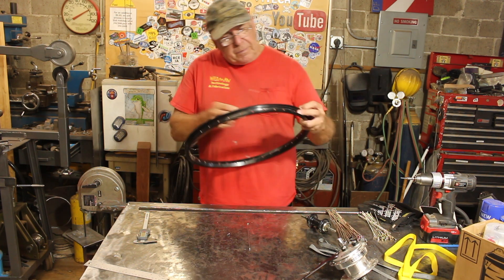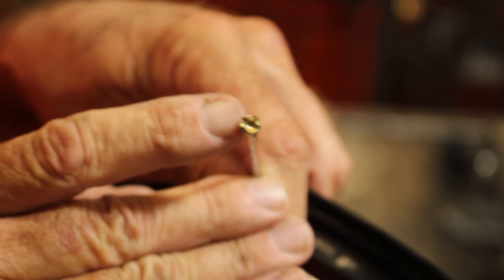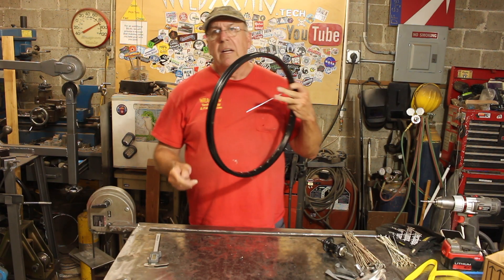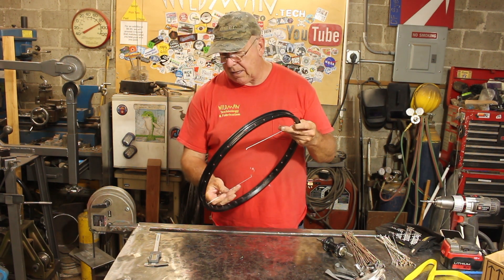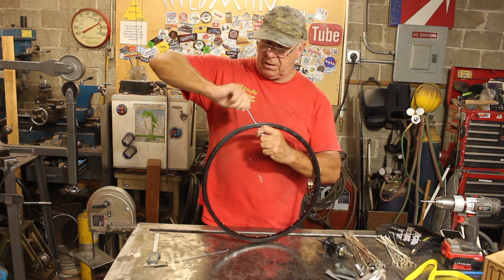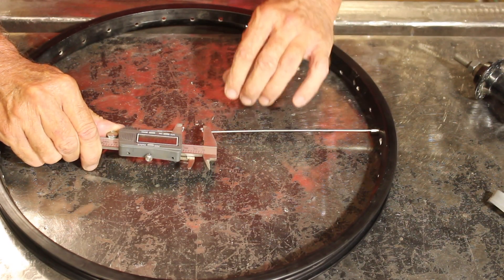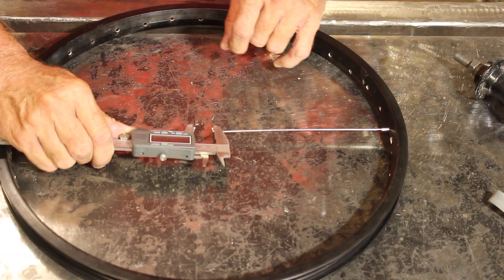What we do is take one spoke, insert it into one of the spoke holes and screw the nipple down until the spoke is even with the bottom of the slot in the nipple. This is a 36-hole rim, so go 18 spoke holes away and insert a spoke there as well. Screw the nipple down until the spoke is flush with the bottom of the slot. Now come in with a digital caliper and measure the distance between those two spokes — I've got 21.3 millimeters. So 185 millimeters times 2 equals 370, plus 21 millimeters is 391. That is our effective rim diameter: 391 millimeters.